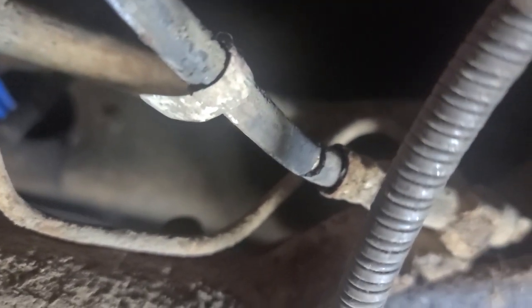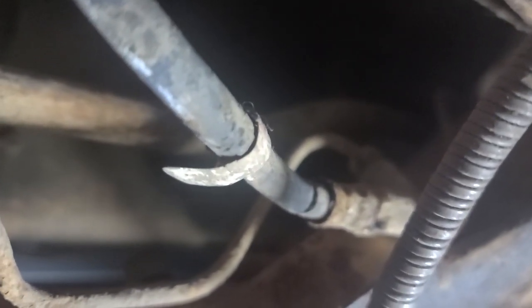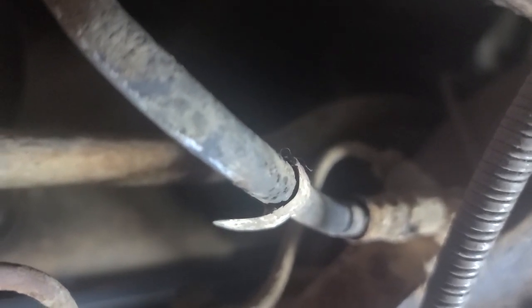Here's a much better view of that piece that's going to get replaced. This is the line that goes up to the front and connects this little bracket which goes down to that little T right down there — we're going to replace that rubber hose. While it's off I'm going to try to pump some brake fluid through there to make sure it's clear and everything can flow. I'm certain that's our problem. So this is going to become a part one video — stay tuned, make sure you subscribe, and check it out when I replace this and get the rear brakes bled. I was able to bleed the front brakes; they don't have a problem. But this particular master cylinder has two circuits — one for the front and one for the back — so I just could not get pressure to the back line. I'm going to replace this rubber hose, so stay tuned and check us out when we get to part two.